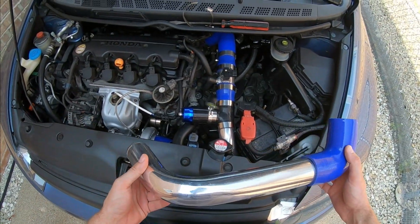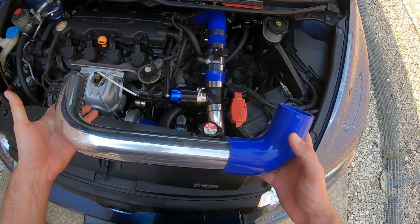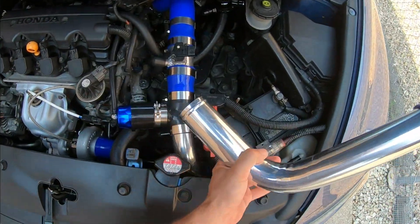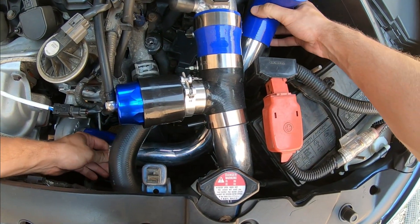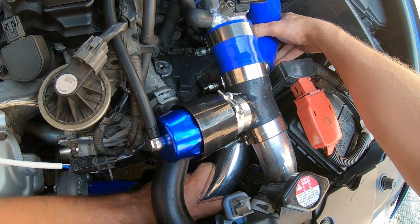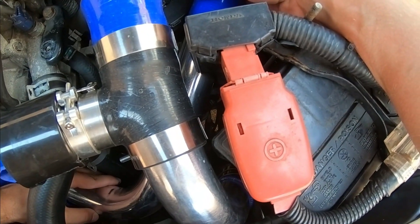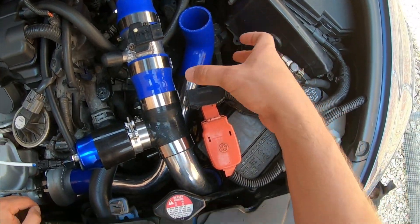Here's how you want to orient the pipe — going into the turbo with a 90-degree turn. I can't fabricate yet; I have a TIG welder but no idea what I'm doing with pie cuts, so we're using what we've got. That coupler is our 90. I'm going to feed everything through here, right under the intake charge pipes — you can see how close that is. We'll feather it in a little bit, give it a slight angle, and it sits right on the money — not touching the radiator, maybe 10–15mm of clearance, going right under the pipe.